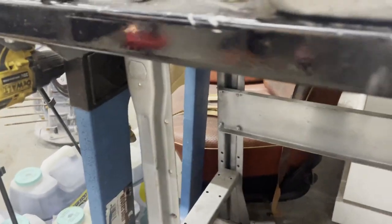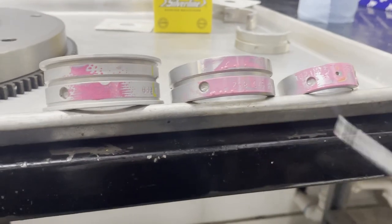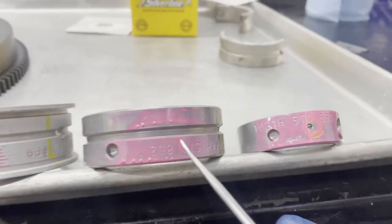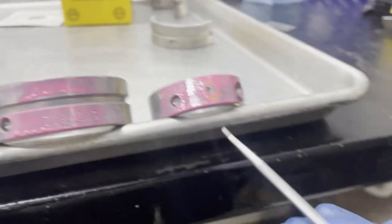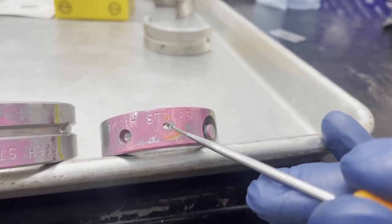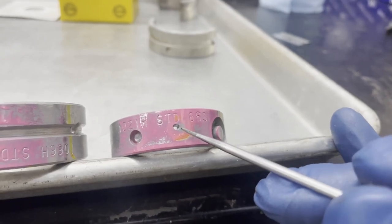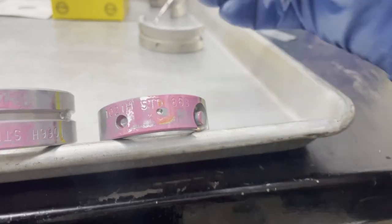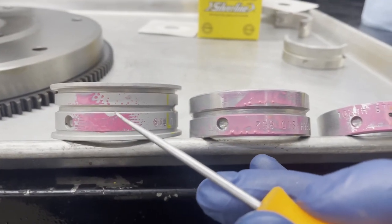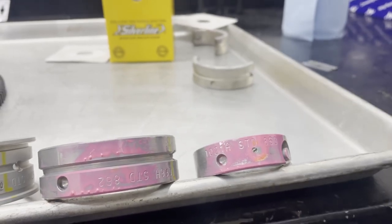So now that I have that mark — it's not a lot, it's not as bad as I've seen — I am going to do all the bearings, and I will actually take a rotary tool with a diamond head bit and just take that little tiny bit out to give it a little bit more flow. So I've gotten all these painted up. You can see this little dip here — a little bit of overlap, we're going to open that up with a Dremel. This one's actually okay, that lines up pretty good, so we don't have to touch that one. This one doesn't have a channel, but it does have this tiny little hole here, and you can see there's a tiny bit of area that's missing. I'm waiting to hear from Jawbreaker whether or not it's worth opening that guy up or if it'll kind of screw up the surface on the inside. I'm going to do the bearing shells on the other ones and then hog those out as well.